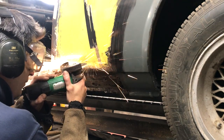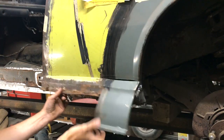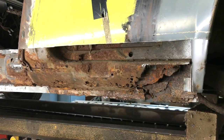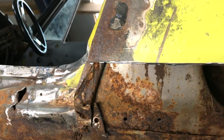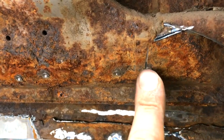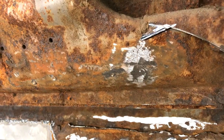Here's a tip for you. When you don't know what's on the other side of a panel, don't cut all the way through. Halfway will probably do the job — just bend it until it breaks. If you do accidentally cut too deep while removing panels, you can simply grind away that section to make it look like you never messed up.